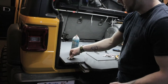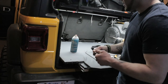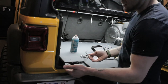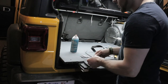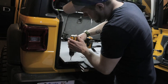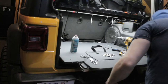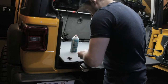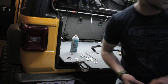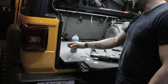Okay, so to install these, I'll reinstall these factory cargo tie-downs. What I'm going to do is use some 6mm bolts and nuts, and on the bottom I'm going to use fender washers. So I'm just going to drill these holes where I want them to mount these in. I'll go ahead and install my cargo hook. I used lock-tight on these bolts too, just so they don't back off on us. And I'm going to do that for the remaining five cargo tie-downs.